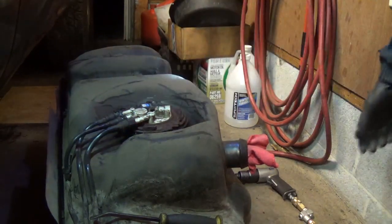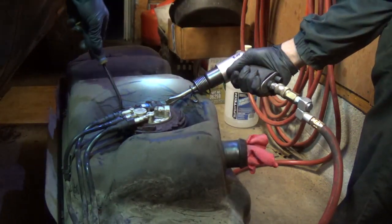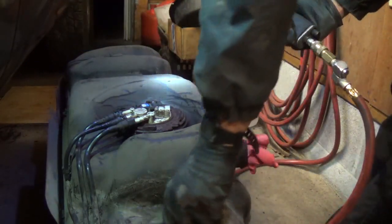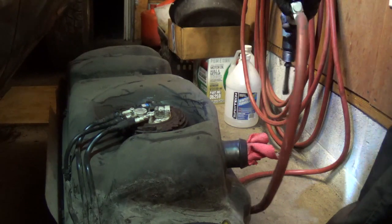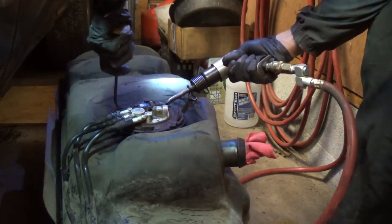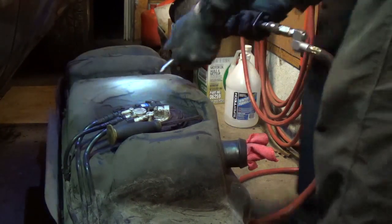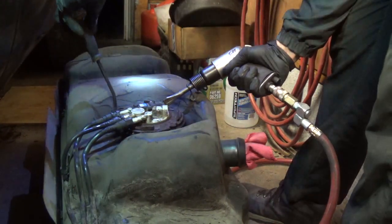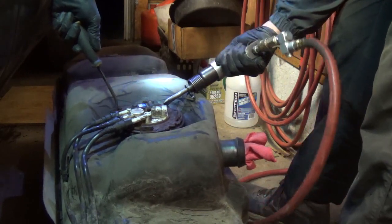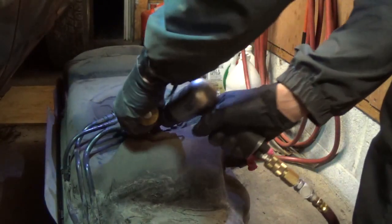We have the area cleaned off. Take a little air chisel, prop it up against the ring, and as Scotty Kilmer would say, pray. Chunks of rust just fly off. Let's dial this back a little bit. There's a little plastic tab that needs to be pried. Maybe chisel on the sides here a little bit to get these tangs busted loose.